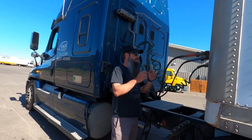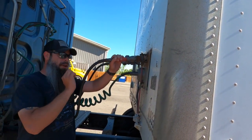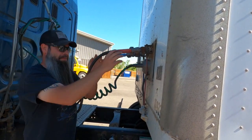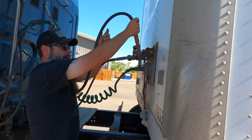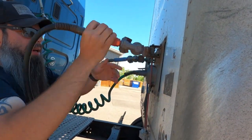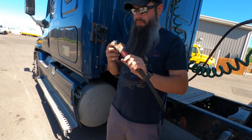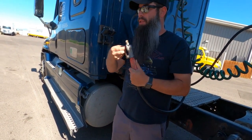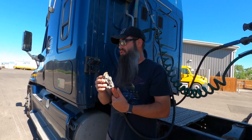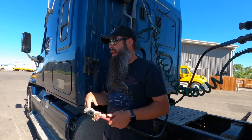Okay, so for right now, I'm just going to go ahead and take these airlines off. On these ones, and most commonly all of them, you're going to be pushing up to get these off. If you pull down, it's not going to do anything. So just go ahead and hit it up, and then they'll release, okay? These are the rubber grommets that I was telling you about. These can ruin a trip in a hurry, right? And they just peel right out of there. Go to your mechanic or your maintenance department, truck stops have them, get yourself a bag of these, keep them in the glove box or something like that, okay?